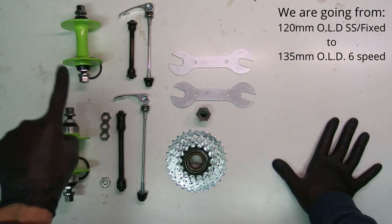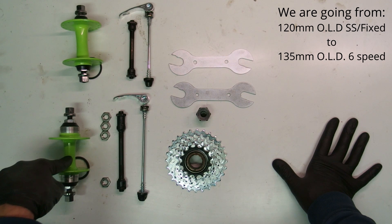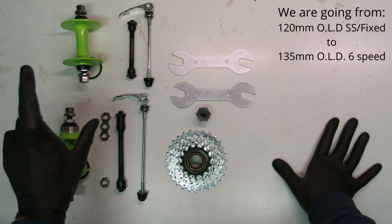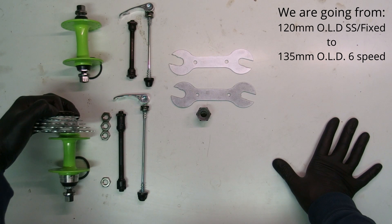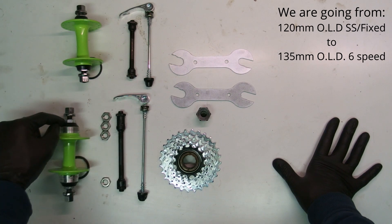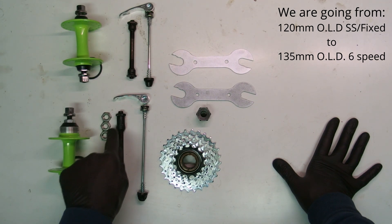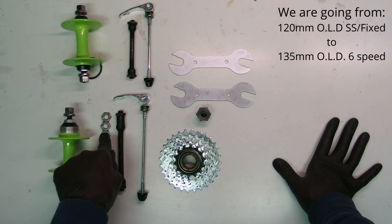The job for today is to get this axle, which is compatible with this quick release, inside this hub, replacing the original axle. This axle is M10 by 1, which is a bit thicker than the original axle which is 3/8 of an inch — making the axle stiffer and less prone to bending because of the freewheel which is going to be installed here. In order to provide space for the cogs, some part of this axle is going to be sticking out on this side. To further make this assembly less prone to bending, I intend to replace this sleeve with these three pre-loaded bolts, which fit on this axle — they are also M10 by 1.